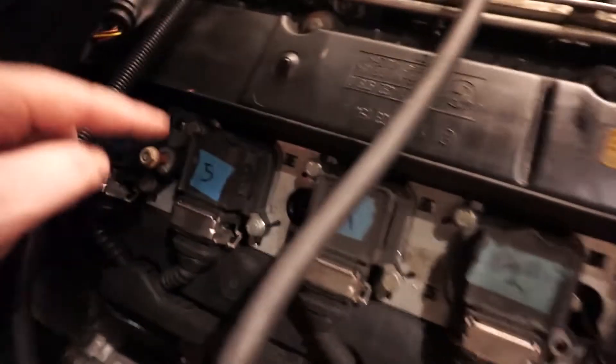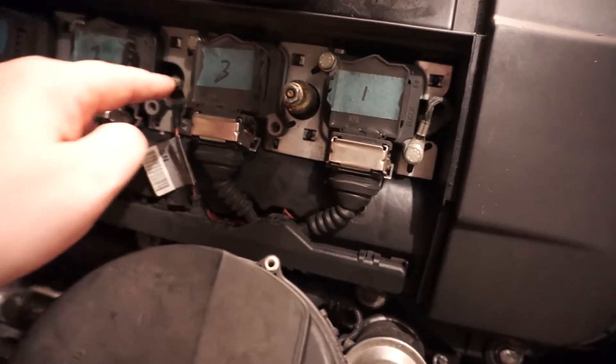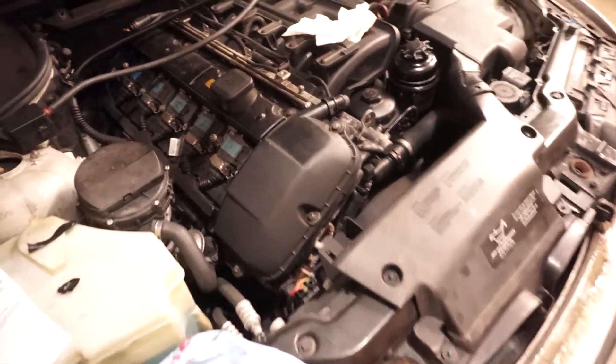The noise was a loose plug in cylinder five — it wasn't super loose but it was losing compression. I swapped the number two and number three coils and now the engine is running smooth, but sometimes it drops the cylinder — you can hear it get rough and then go back to being smooth. It's very weird.